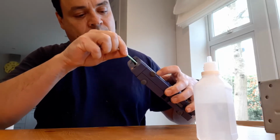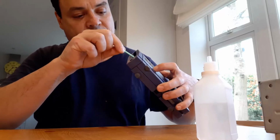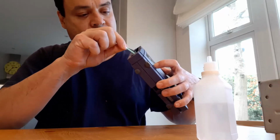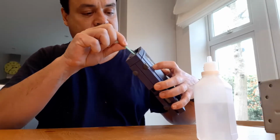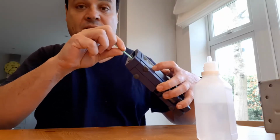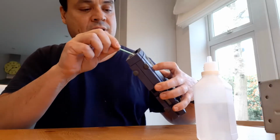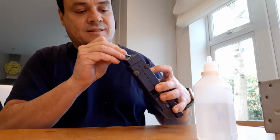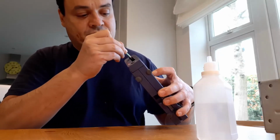There is a problem known as the click of death that basically causes the head of the zip drive to detach from the enclosure, from the assembly. And because of that, when you put a zip disk into the drive, because the head is loose, it actually crunches the disk, rendering it unusable.